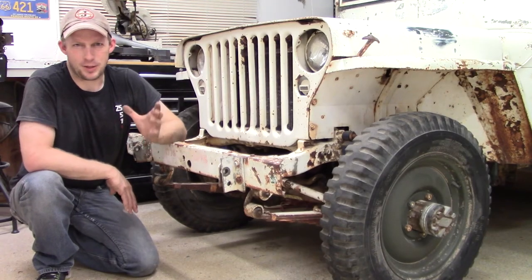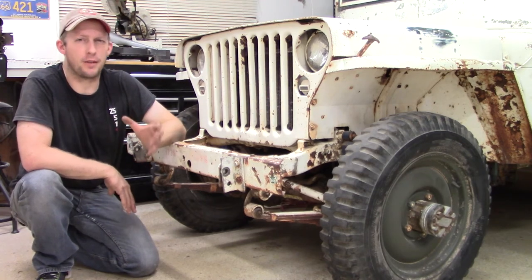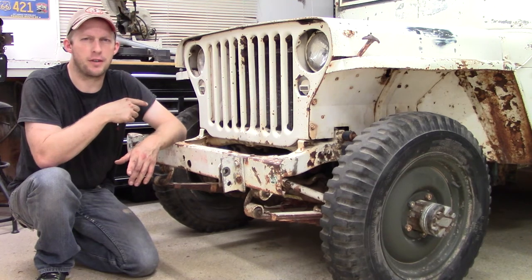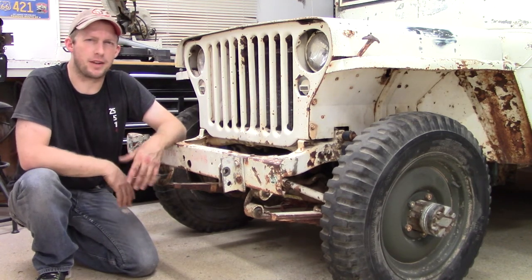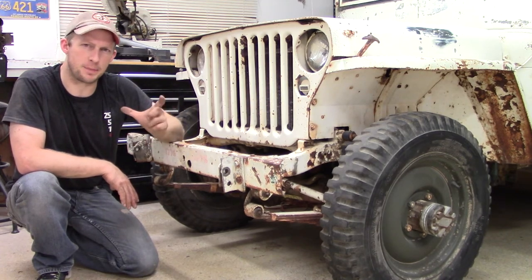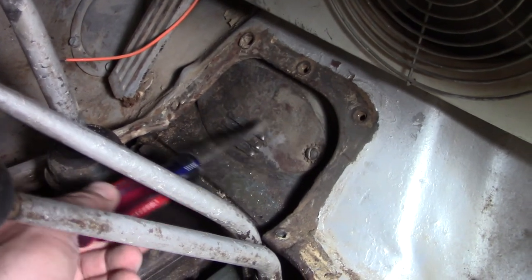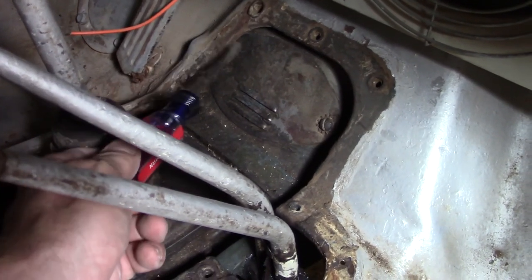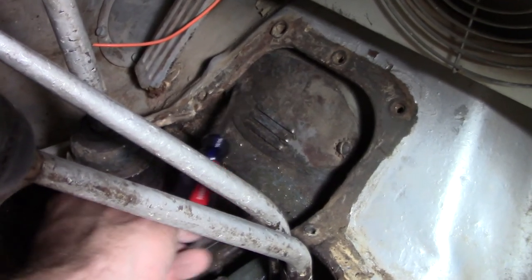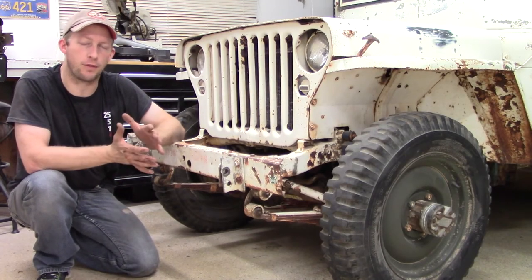Well, that's a wrap for this ring gear replacement job, and what a job it has been. A few things I didn't film. I didn't get the front drive shaft filmed. I was just working through some of the stuff and didn't get a camera under there. Also, the plate, the inspection cover, which is on the bell housing, I put that on, which actually was a huge job because it's so close to the floor. So when you're putting this back together, real important, make sure that you get the inspection cover on before you get it fully in there.